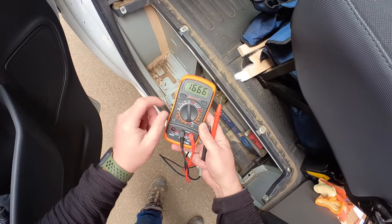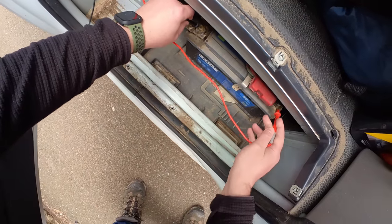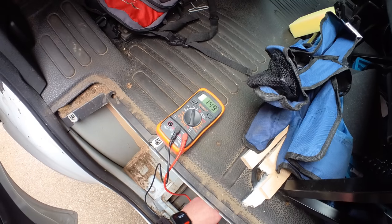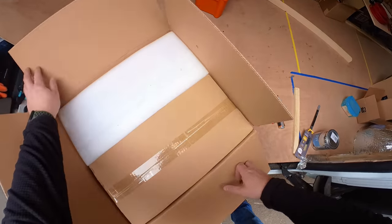Testing to see if you've got a smart alternator is really easy — just start your van up and let it run for a couple of minutes. Using a voltmeter, you just need to test the voltage across the battery. It's reading at 14.9 volts. Leave the van running for about five to ten minutes and test again — that voltage should drop to around 13 to 13.5 volts if it's a smart alternator. If it still reads 14 to 14.5, you've got a regular alternator.